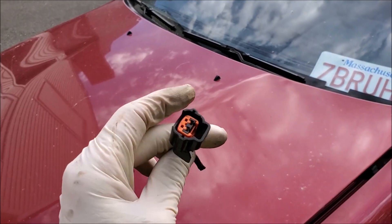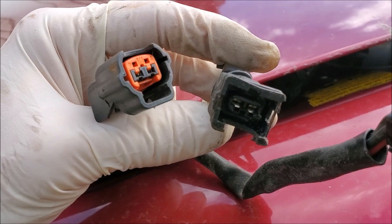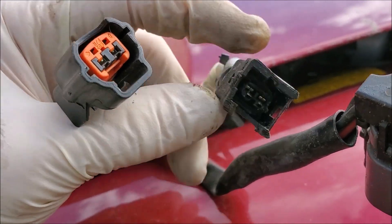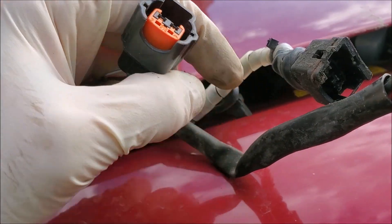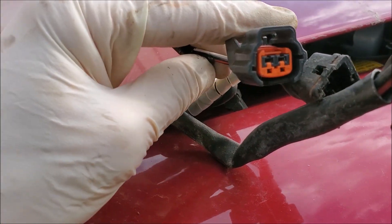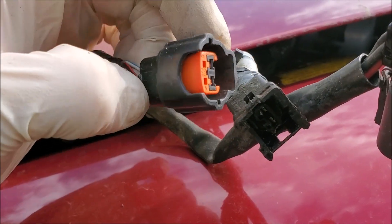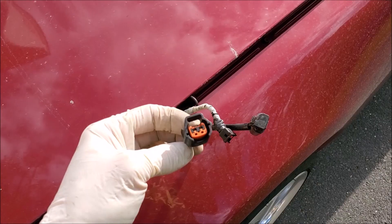After looking at the fuel rail to plenum setup, all you have to do is sort out the connectors — the two connector types are different. This is the new style injector connector and this is the old style. The easiest way is to de-pin: take the plastic cap off the old one and put it on the new one. Or you can splice into the wires — open up the wiring casing, see what colors go where, and match them up to all six. For me, I like keeping things as stock as possible, so I might try to de-pin first, and if that doesn't work I'll splice. I'll keep you guys updated.